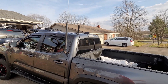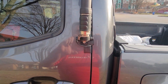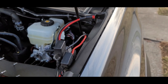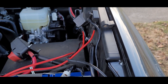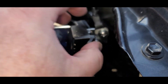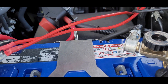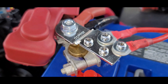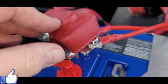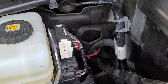As long as you get a really good ground, you're in good shape. You can see I've got the antennas installed — here's a preview shot of how things more or less ended up. I wanted everything on the driver's side and wanted to be able to see the antenna in the rear view mirror. Up front, I've got the pigtails for power for both radios connected to the upgraded battery, and they terminate in Anderson power poles. I ran cables through the firewall, through the master grommet, which was a little bit of a trick — but if you stick with it, you can get it to go. These are all fused as well.